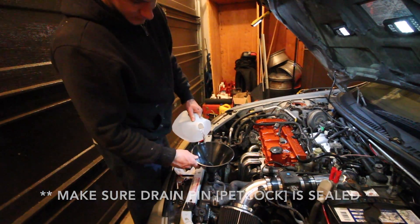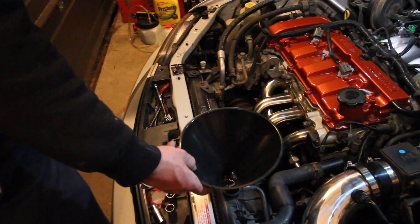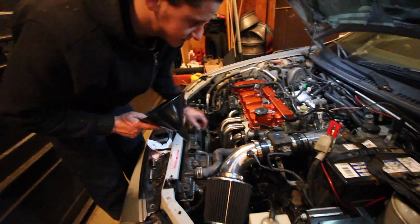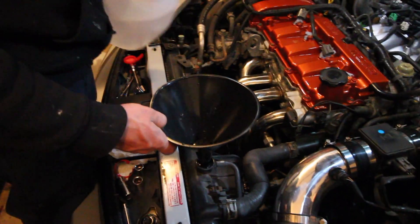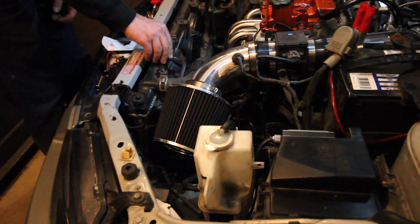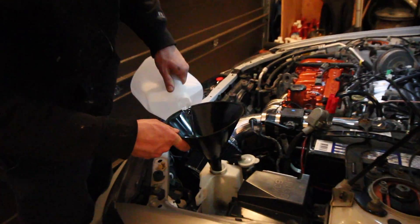Petcock is tight. I checked it the other night. Just be safe. It is water though — this is why we're doing water. The radiator's full but I think it's going through the tube now back into the engine. That's why it's bubbling and taking so long. That'll be good enough to start it — it'll suck some more down once the engine starts running. I'll top this off too.